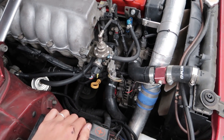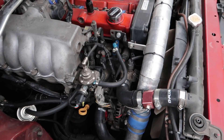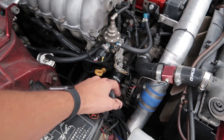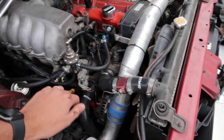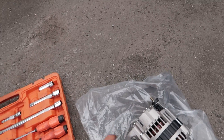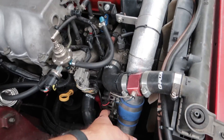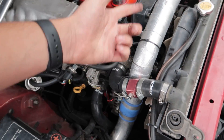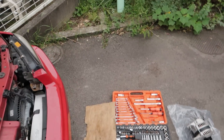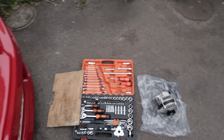Fortunately, replacing an alternator on these is actually really simple — roughly four bolts, maybe one or two more or less. I just have to undo the tensioner, which pulls the belt off, and then there's one bolt that goes through the bottom bracket all the way through that I unbolt, and the whole thing comes off. You can normally pull them out through the top, but if you have intercooler piping like I do, just drop them straight down. I just need 12 and 14mm spanners — I'll smash this out real quick and then we'll take it for a drive.